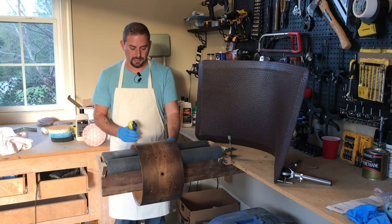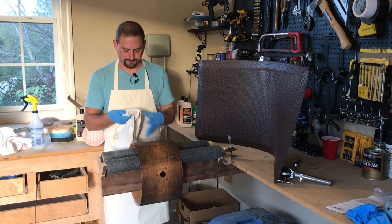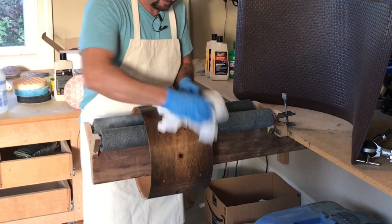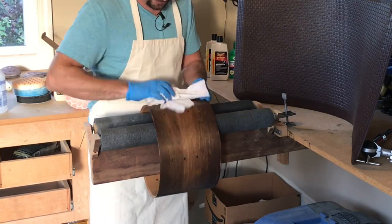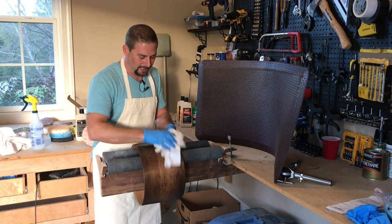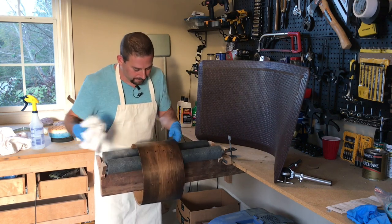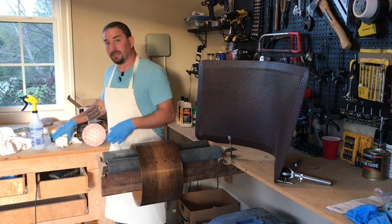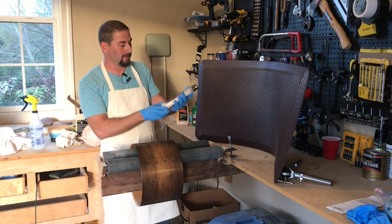So I'm going to take my heavy cut rag, a little bit of water, and wipe this stuff off. This roller assembly is really clutch when you're doing this — if you haven't checked out the video I did on how to build it, it's worth taking the time; it wasn't particularly expensive and it really made this job so much easier. Now wiping this off, I have a little bit of a dull sheen for my finish. But with this system of using different finer grade compounds, it actually does a really nice job shining it up. This is actually pretty even all the way around. So now we're going to do the same exact thing but with our medium cut compound.